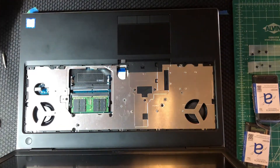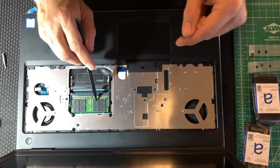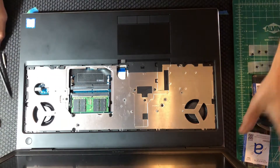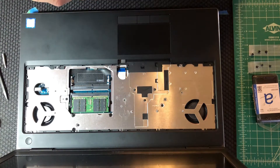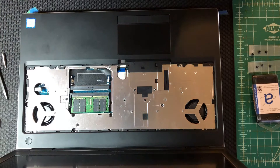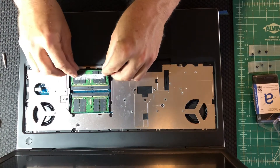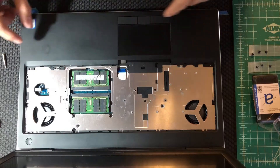There's my one extra RAM slot. This slot was the first one filled when I bought the machine and it has a 32 gig chip in it too, so there's now 64 gig here. We previously added 32 gig to the bottom of the machine, and this will be the last 32 gig chip. Using the fourth identical RAM chip, it fits into the key slot, the pins engage, and it locks into place.